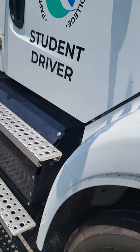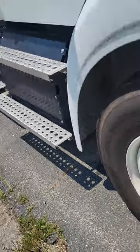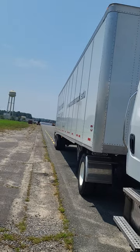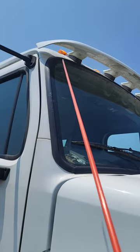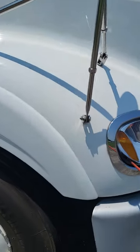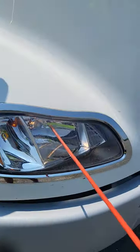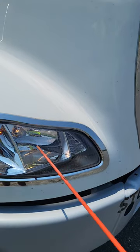Now let's take a look at our list. I'm going to go a little bit out of order and catch all of my lights out here too, because you do have to describe the lights on the outside. We checked them to make sure they were working, but now we have to make sure they're there. Up in the corner of the trailer is a trailer clearance light; right over here is a tractor clearance light. The three lights in the middle are identification lights or ID lights. Then we have a turn signal here and a turn signal there — we put them all together because they're amber in color. They're not chipped, cracked, or broken, not missing any nuts, bolts, or screws, and I see no signs of condensation. Then I come to my headlight — it's not chipped, cracked, or broken, not missing nuts, bolts, or screws, it's clear in color, and I see no signs of condensation.